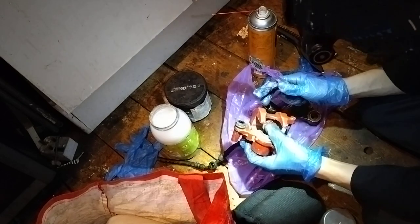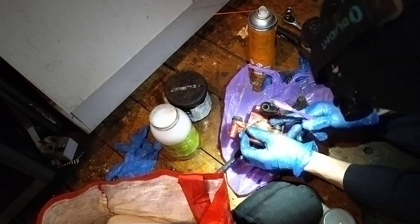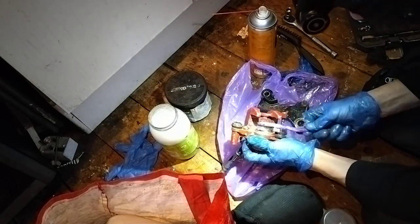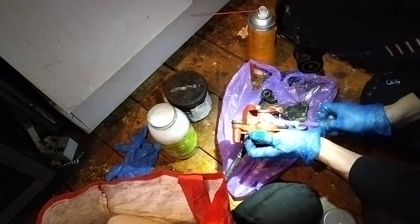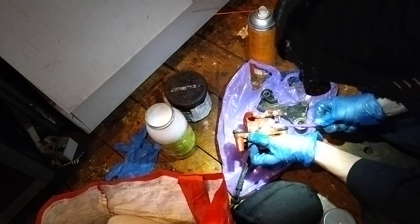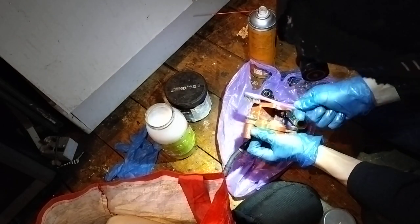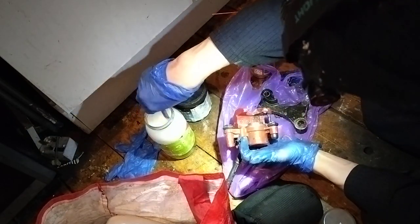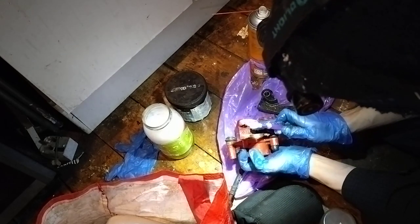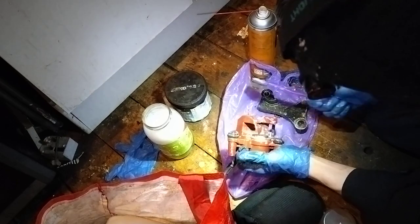There should be some metal plates here as well - I haven't got them on me at the minute. Same again, you can't find them separately, you'd have to buy the whole unit. I'll clean the caliper up - not too much soapy water and brake cleaner at hand. Also, because it's not on the bike, I won't be able to pump the piston out. If it were on the bike, a couple of pumps would push it out a bit more for better cleaning. I'll clean it up as best I can and do the rest when it's back on the bike.